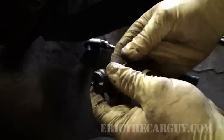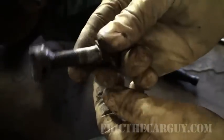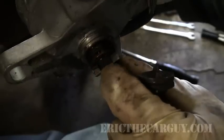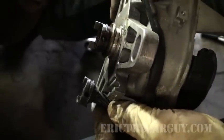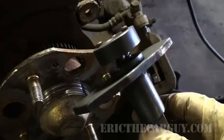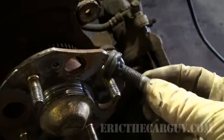I've worked on a lot of Hondas and I'm going to show you something else — my caliper turning inner tool. This is actually a lot more efficient than the other tool. All this is is a bolt with a distributor keyway welded onto the end of it. If you've got an old distributor, there's a roll pin behind the keyway that you can take out once you get the snap ring out — you can get this piece off, weld that onto a bolt, and it's shaved down a little bit to accommodate the caliper. You've got yourself a caliper piston turning tool. I'm going to show you both ways — the actual tool you may be able to rent or purchase at your auto parts store, and ultimately I'll end up doing it with mine.